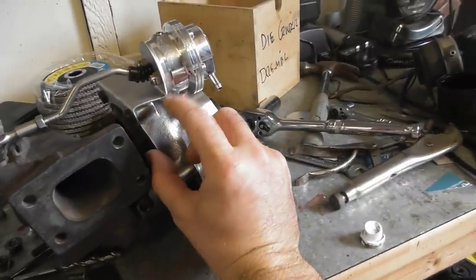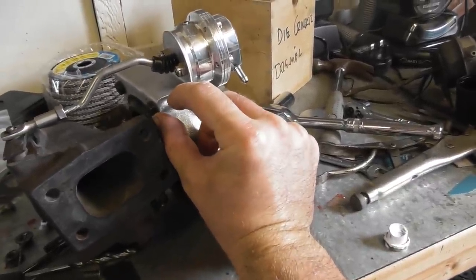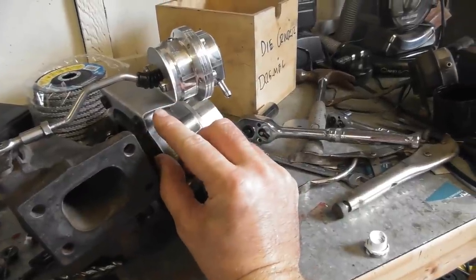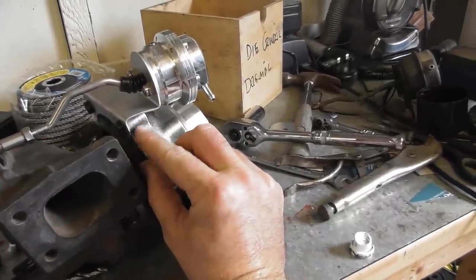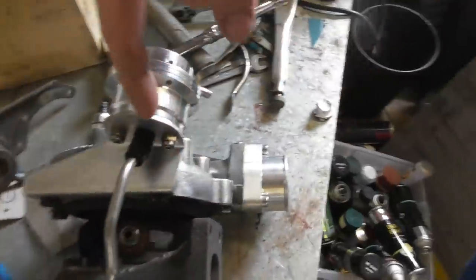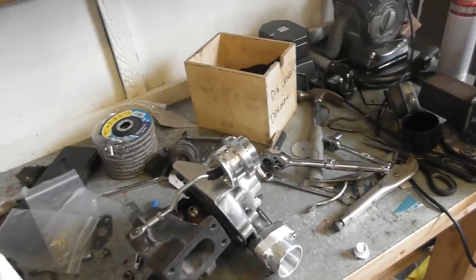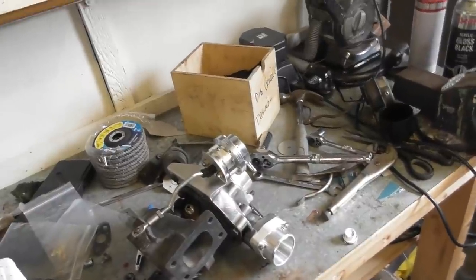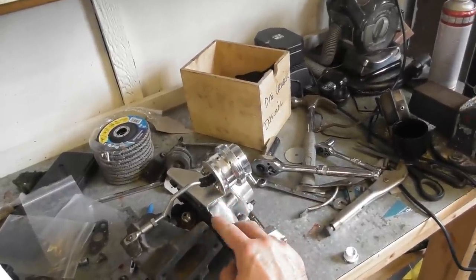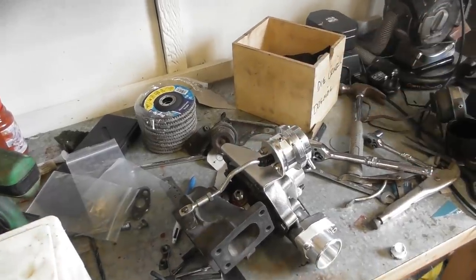And by the time I've got a gusset across this end, any bending will be countered by the bit of flat which goes across there, and that's so close to where that rod is actuating that I think that'll be good. So yeah, I'm going to get the welder, get my grinder, cut a strip of flat to go across there, and make a little triangular gusset to go in there, and then we should be good.